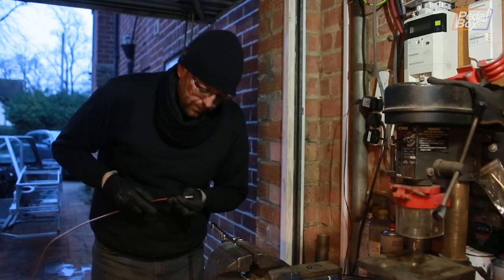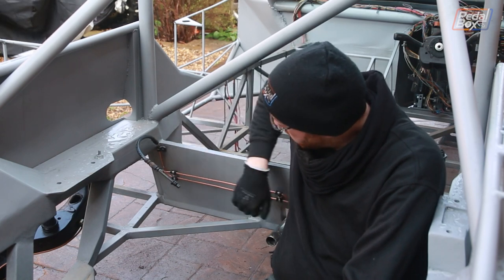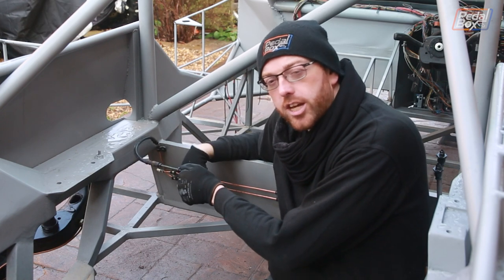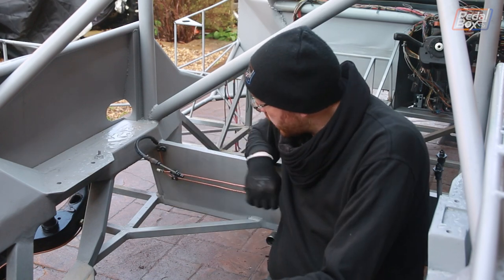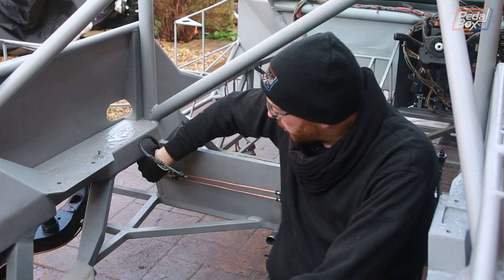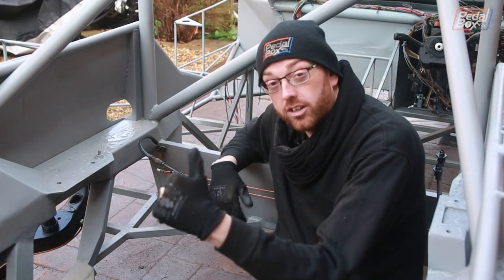You can see the nut now stays on the end of the pipe, and when you crank that down it fits into the end of the fitting — that's what makes your seal. We've got those lines we made up last night fitted onto the back of the car, all fastened in nicely. I also did the clutch line — before we took the engine out I took a couple of measurements for where the alignment needs to be for the fitting to go into the cylinder on the gearbox, and the minimum space we have for the radius, and it should fit really nicely without getting in the way of anything like the boost pipe or the battery tray. If you're keeping score at home for how many times I forgot to put a fitting on the pipe before flaring it — good news, I'm up to nine, because I forgot on each one of these pipes when doing the second end.